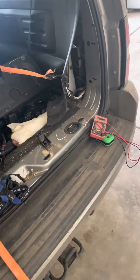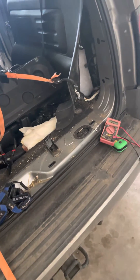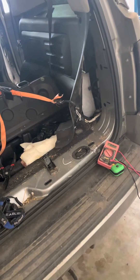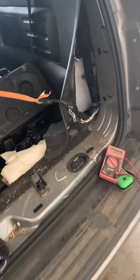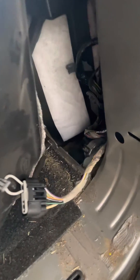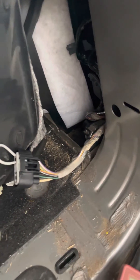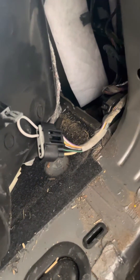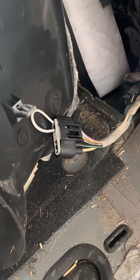This is a good test to see if your actual fuel pump is bad on a 2008 Ford Explorer. Over in the corner is the fuel pump driver module, which modulates the pressure by turning the pump on and off quickly. You can bypass the module and just put power straight to the fuel pump by disconnecting the connector for the module.